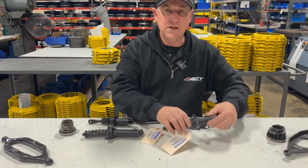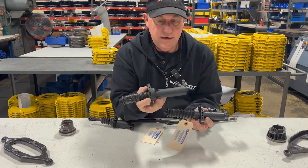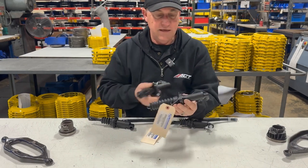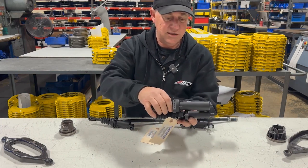However, they also have a smaller slave cylinder size as well. On the JK it's a seven-eighths, and it's three-quarter on the JL. Some have said that it's a shorter cylinder on the newer ones — it's really not, and not a significant change in length.